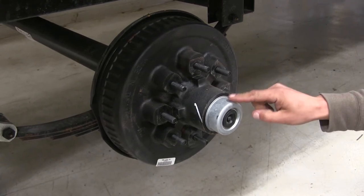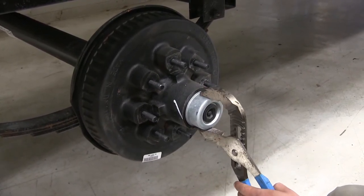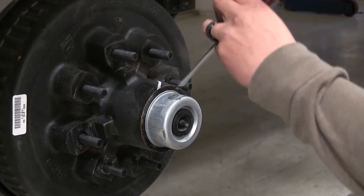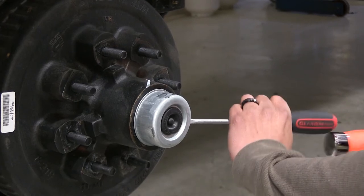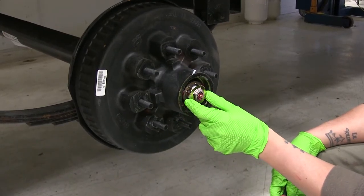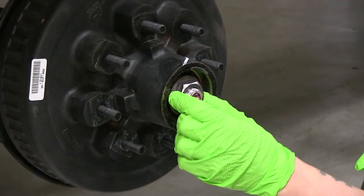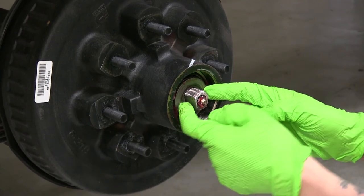We already removed our wheel and tire, now we're going to have to remove the dust cap on the end of our axle. Grab a pair of channel locks, just want to be careful not to crush that cap, but you want to get a good grip on it. Kind of work it back and forth a little bit until we can get it broken loose. If you're having trouble, you might want to grab a flathead screwdriver and very carefully try to get behind the flange on the cap so we can get it started and work our way around. We're going to remove that cap. On the inside it may look a little bit different — you may have a cotter pin or something else — but we're going to need to remove the retaining pin or nut at the end. We're going to remove that and hold on to it because we will be using it later, and we should have a nut that we can back off and remove, and there'll be a plate washer right behind that.